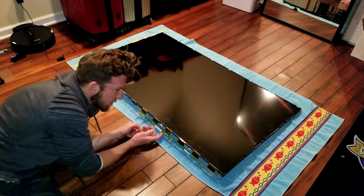Flip the television over. Put your boards back in the little clicky plastic holders, put in your little screws, and put the guards back on. Reconnect your T-Con ribbons and make sure you put back your display stand pieces as well. After all your guards and stands are on and T-Con is reconnected, remember to replug this cable right into your main board. Reconnect the Wi-Fi module and run the cord back over there, put the cover on, and put all your screws around the television making sure they're in the right holes.